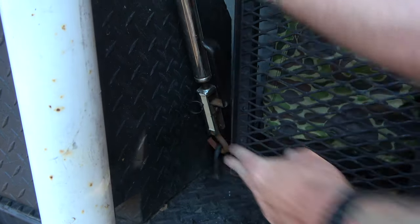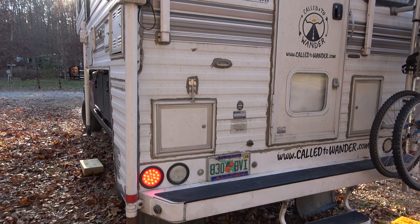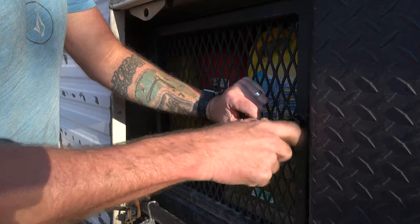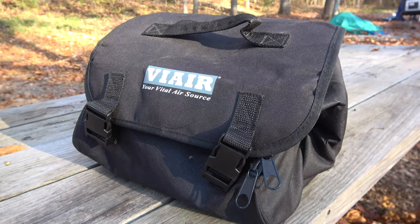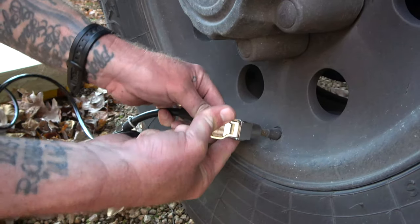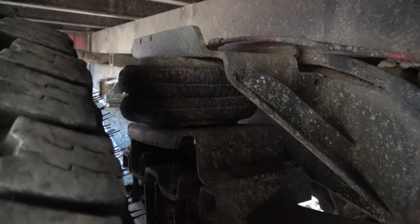Now you're ready to do your final check. Make sure that all of your tie-downs are secure. Test your electrical harness to make sure that your brake lights, turn signals, and reverse lights all work. You're also going to want to stow any additional items in the appropriate places — in our case, we keep extra fluids, fuel, and leveling blocks in an outside storage area. Finally, remember to inflate your vehicle tires accordingly. We keep ours at a maximum inflation of 80 PSI. Note, if you have airbag suspension as we do, you'll also want to inflate this accordingly as well.